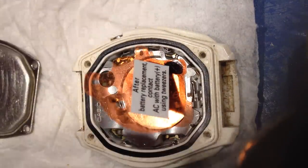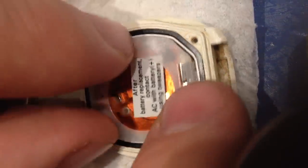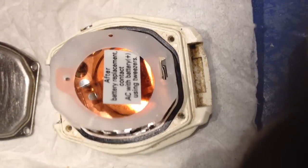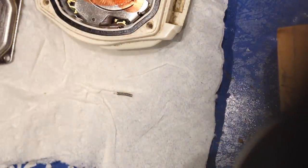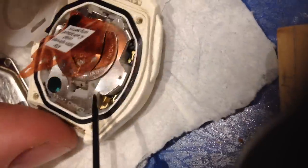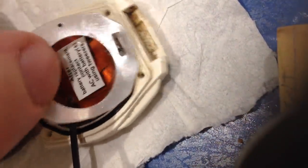It should be counting from 12:00 — there, everything normal, Sunday in 1995. So that's how the AC reset is done — fairly straightforward. From here on it just needs to be covered with the plastic, and don't forget to place this super mini spring into place — it's tiny. The tiny spring lives right next to the latch.